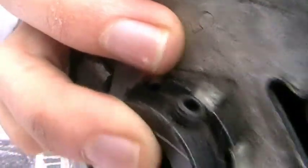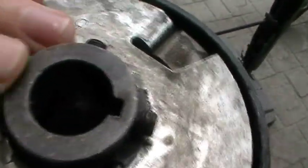Let me tell you about the sprocket I'm going to get. Here's an old crappy Max Torque clutch from my old go-kart — see how it has this keyway? It has these little allen heads that screw in to the clutch. The sprocket is going to be like that: it'll have a keyway and two allen heads, and it's going to be a one-inch bore — this one is three-fourths bore. It'll slide onto the spline, and I might have to weld it, but I'm just going to drill the allen screws down into the spline. This spline is the toughest part in the golf cart, so I doubt it will get damaged. If the screws give out, I'll just weld it.